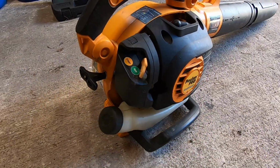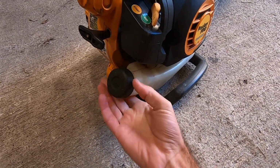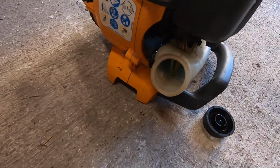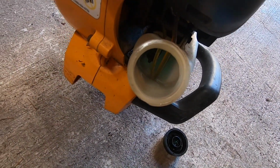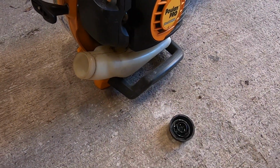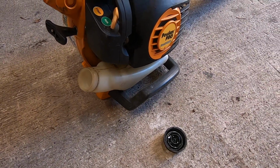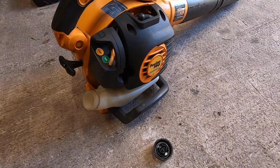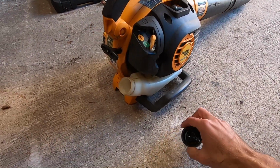All right. Well, I put a little bit of my own fuel in there. The tank was dry originally. The only thing I did notice, maybe you guys can see, the gas lines don't look too bad in here, but the filter is disconnected, so I'm gonna have to dig around in there. That could be a culprit, as maybe it sucked up a little something from the tank, and maybe there's a little dirt in the carb. So let's just go ahead and see if it'll start.